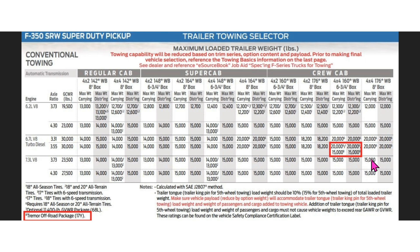That's my suspicion on why it's the same 15,000 pounds for both. Moving to F-350 conventional towing with the 6.7 diesel — finding the eight to identify the Tremor package — it's also 15,000 pounds for the Tremor and 20,000 pounds for the non-Tremor. Again you're losing 5,000 pounds, exactly the same as the F-250. So diesel guys with the F-350, if you go Tremor you lose that 5,000 pounds. Gas F-350 guys with the 7.3 stay the same — you don't lose anything.